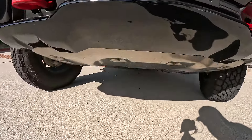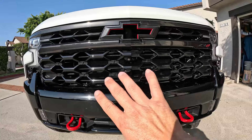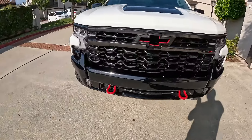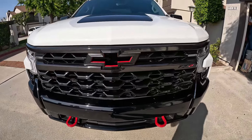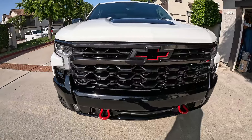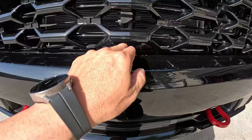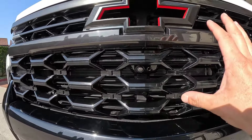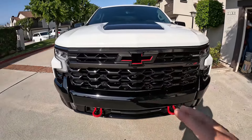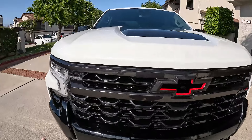Now working from the grille down to the skid plate. The grille swap is very simple - you take the old one off, the whole front end comes apart, there are videos on my page showing how to take that stuff off. I got this grille for a steal - very cheap. You can find them online, don't let people try to upsell you. Now, in order for the grille to work, you need to replace the radiator shutter in the back. The one that originally comes with your truck for the original grille will not work, so you're going to need to replace the radiator shutter.